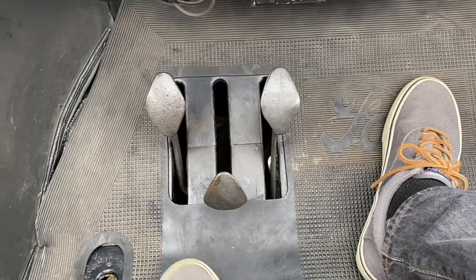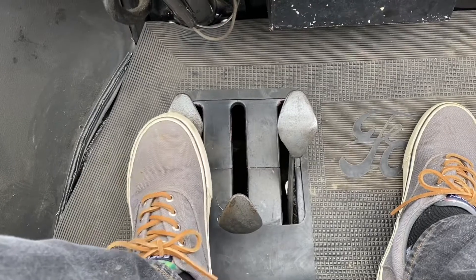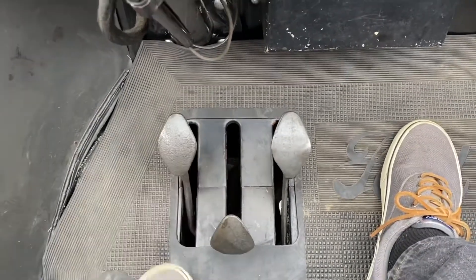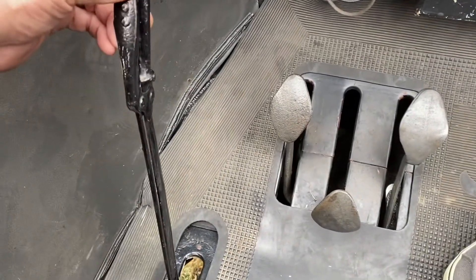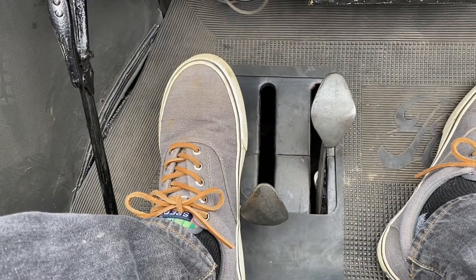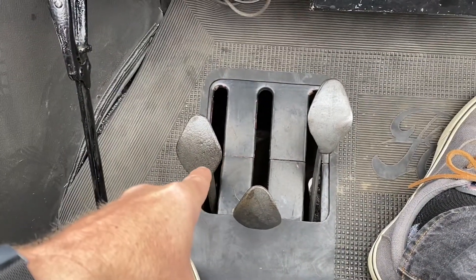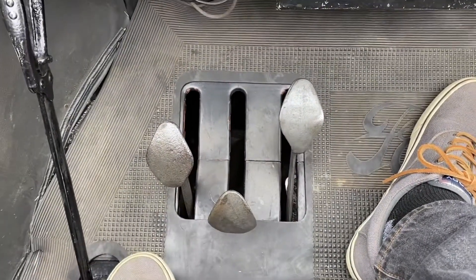The car's all back together. To recap what we did: we tightened up those bands. Right now the clutch pedal is in the neutral position. If I push it all the way down, that engages and pinches the band for low speed. To go to high speed, you release your foot, but the parking brake lever also has to go all the way forward and then it pops up. Holding your foot here is actually neutral; all the way down is low speed. After raising your foot with the lever down, that brings it to high speed. The middle pedal is reverse, and the far right is your brake.